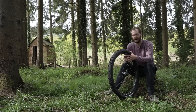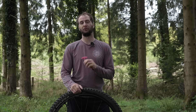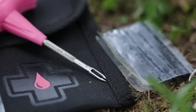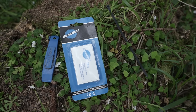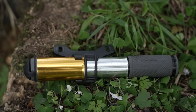What do we do if we do get an actual hole or a proper puncture? There are a few tools you'll need to fix a tubeless puncture: a tubeless tire plugger with bacon strips to plug the hole, tubeless tire boots for sidewall slits, replacement sealant because you will lose some through the hole, and obviously a pump to put air back in.